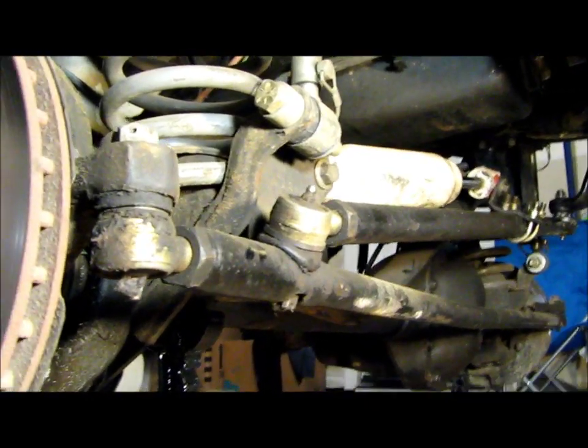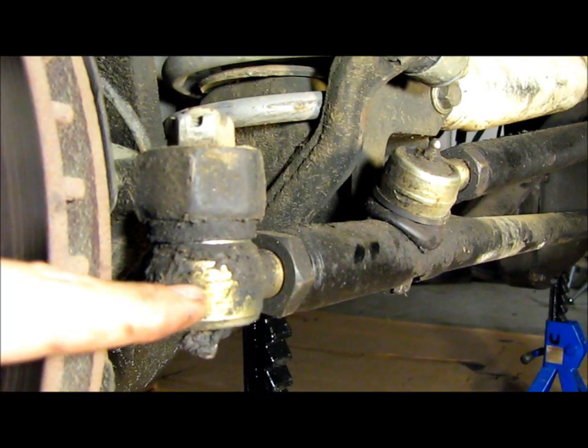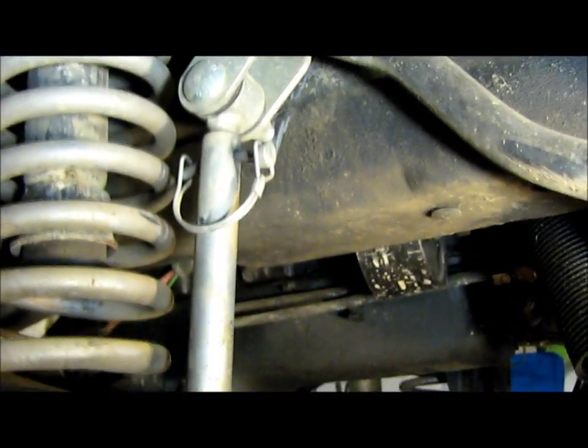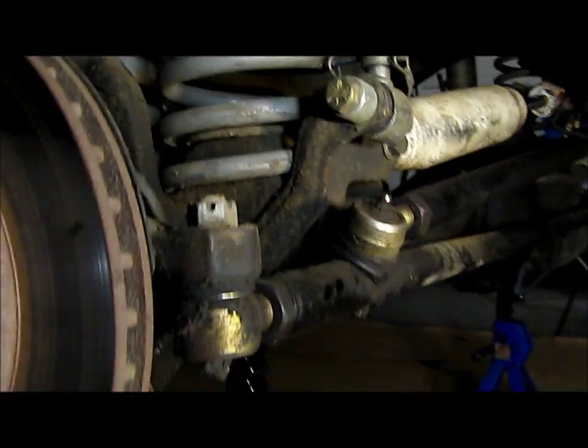Also, what we're gonna do, it's over the knuckle system. So instead of being below the steering knuckle here, the tie rod will be up above. The drag link's still gonna come down, bolt down here. I guess that's just clearance issues with the sway bar connection here. So they do it down the bottom, but I still have tons of clearance. It just comes out and then starts angling up.